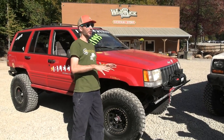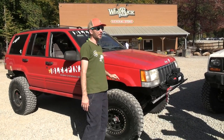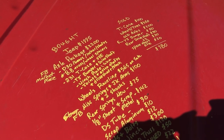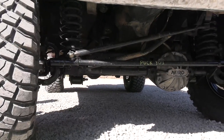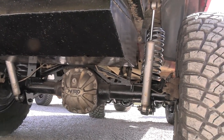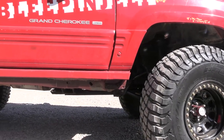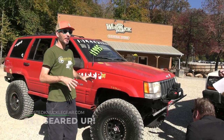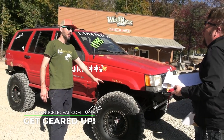For $5,000 total, we have what you see here. I bought from an individual on Facebook an axle package. Now the axle package was more than I wanted to pay, so I have good axles, not so great suspension. It's a Dana 30 up front, 8.8 in the rear, 4.56 gears, trusses on both. We have Raceline wheels, of course, BFG mud terrain tires. The suspension is made up of factory JK parts — these are not JK axles.